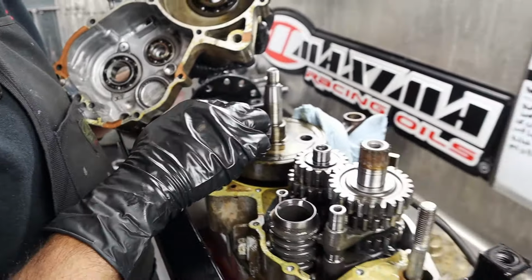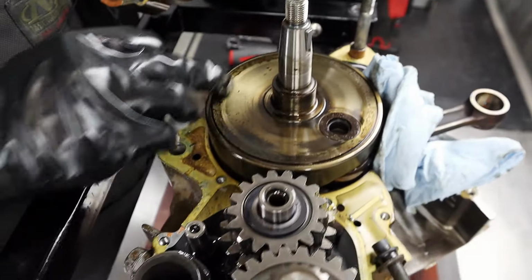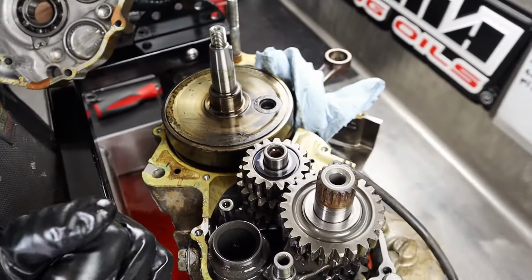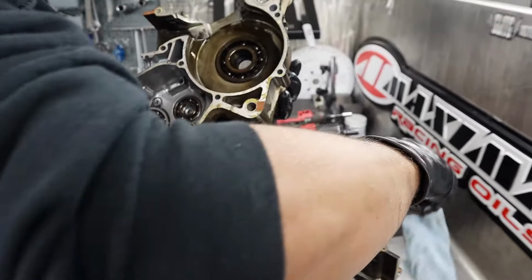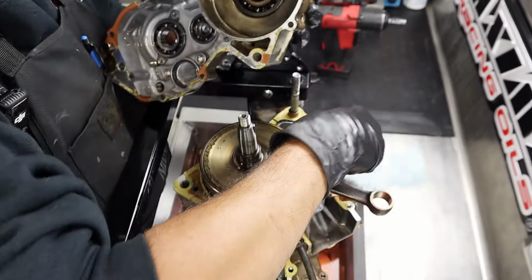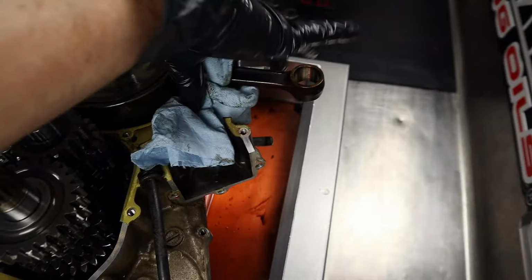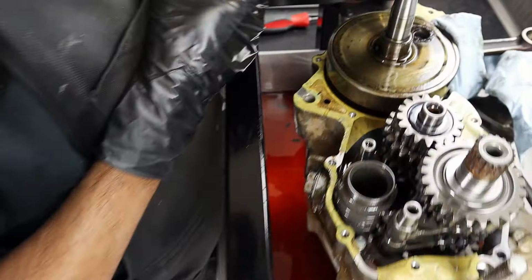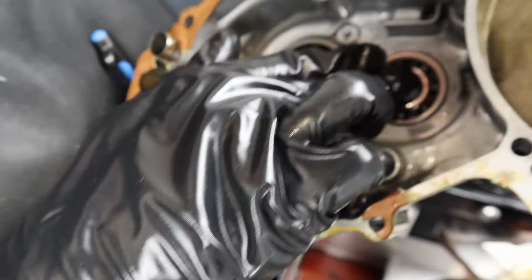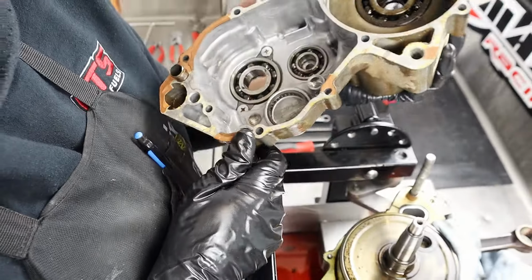Look at that. I think the main bearings were our squealers. Thing's damn near yellow. It's the same color as a gasket. OEM crank, looks like? Looks that way. It's got a key. Couldn't tell what was on the other side. We'll find that later. Either it's a K series rod. These are Japanese bearings, so they're probably original. Do you see anything on the blind side, with the screws and the keepers? These things always get grimy. No, that's never been touched.